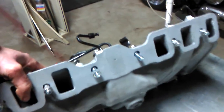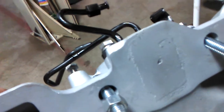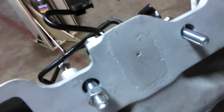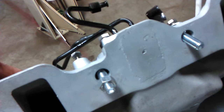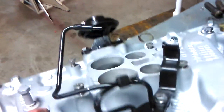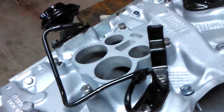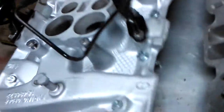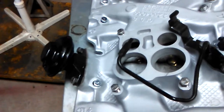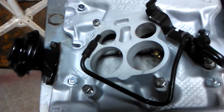Here's something that's going to last a lot longer. What you can see is my partner has actually welded up and blocked — and I think he finished with JB Weld — that entire exhaust gas recirculation and choke heat passage that acts like a hot stove under your carburetor.